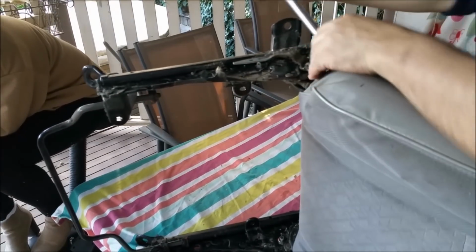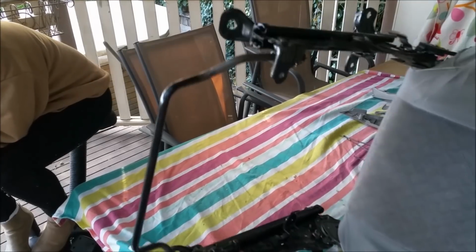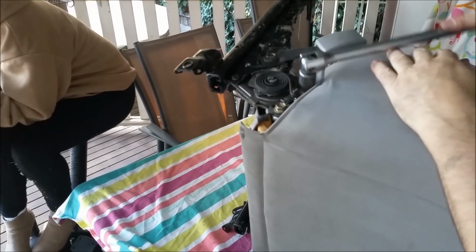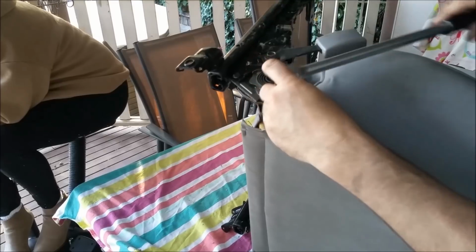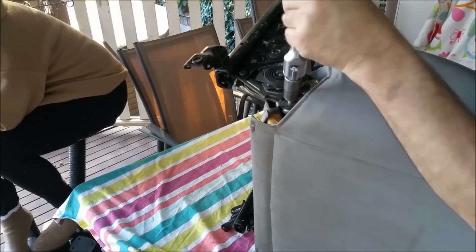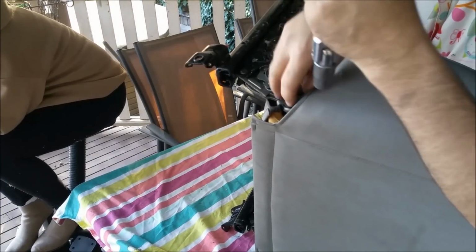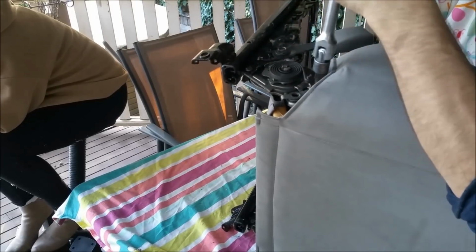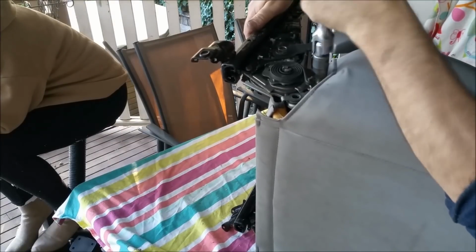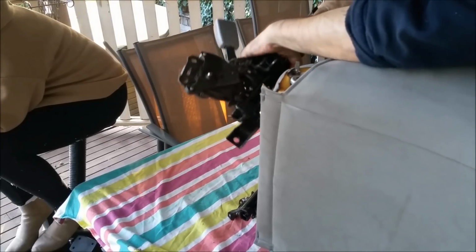And we can just give them a crack with a breaker bar. They're quite tight. They're about 12mm thread, I think. Flick them over. I'm going to do the same thing here. Just give it a good sharp nudge. And there's a bar in the centre of the squab that links the two halves of the recliner together. And then that just will flop down. And you can sort of twist it around just to get the handle off the front. It's clipped on, but it's easier just to twist him around somehow, like that, and that'll withdraw.